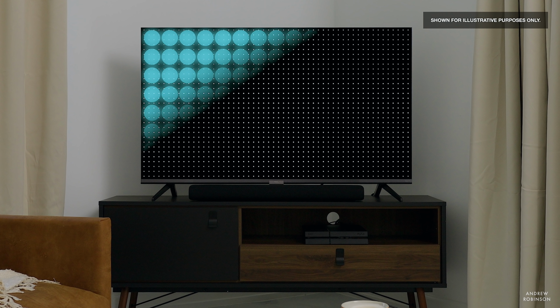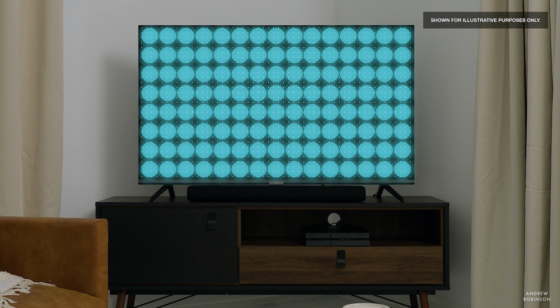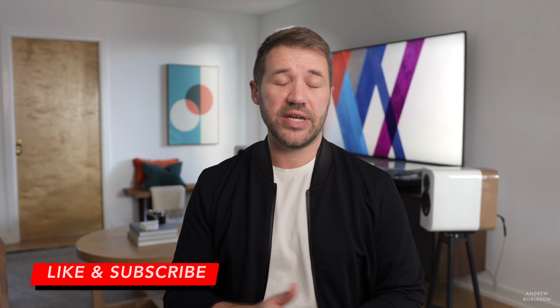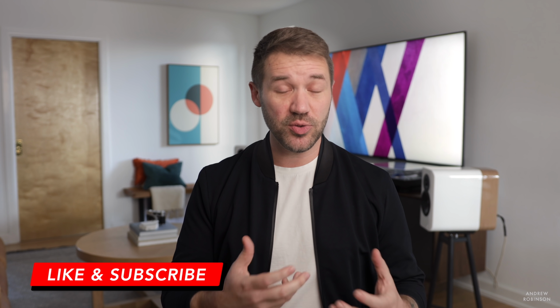Local dimming refers to the severity with which your LCD's LED backlighting system will brighten or dim or turn off altogether based on the content being displayed on screen. And local dimming is very important as it is likely the setting that is going to get you the most dark, rich, inky blacks like what you're going to find with OLED. Now, you can turn local dimming off. I don't recommend that you do this, but you can, but you may find that the image is going to appear a bit washed out and lacking contrast if you do.